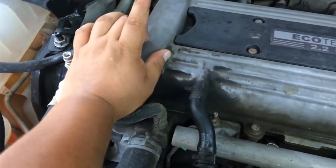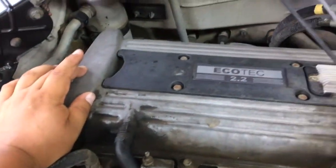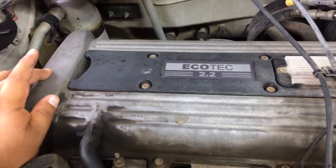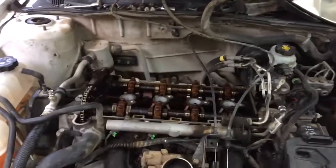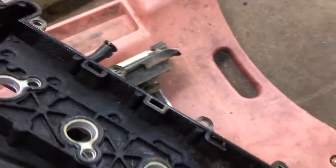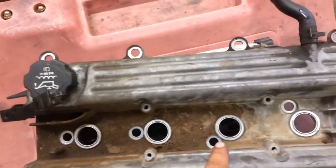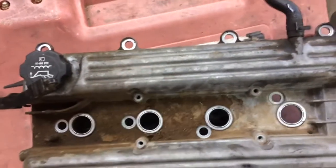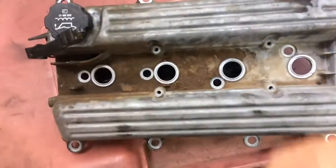With the camshaft gears and a guide up here at the top. Let me take this valve cover off and I'll be back to show you the rest. Alright guys, I took the valve cover off. What I did forget to mention — I apologize — is that once you take the bolts all the way around the valve cover off, there's also going to be four more underneath the ignition coil pack, and they're all 10 millimeters.